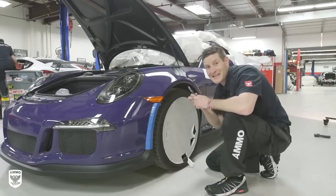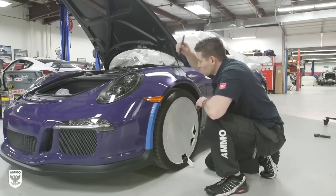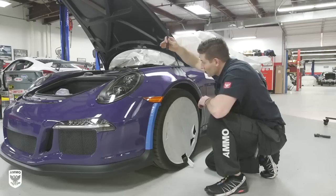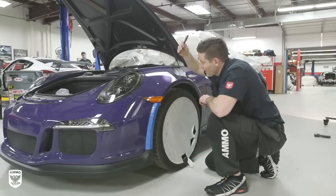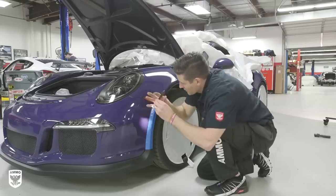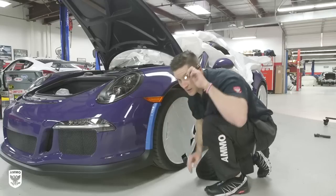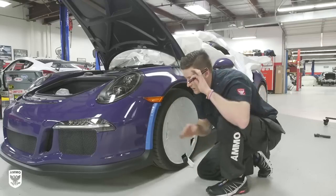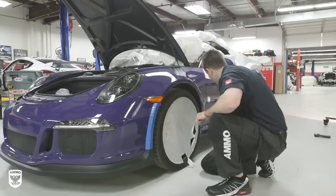Now, if you're looking for paint, the coloration of paint, it is pretty good to look at it from behind your eye or somewhere near there. If you're looking at swirls, you want an angle. Angle for swirls, and when you're looking for paint coloration, meaning you want it to be the same color from panel to panel, I find looking at it directly, you know, from your eye. So color, scratches, color, scratches. That's kind of how I work that.